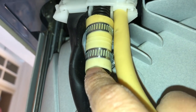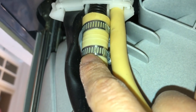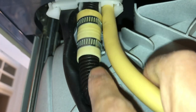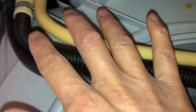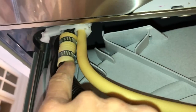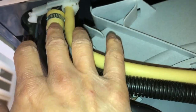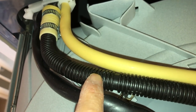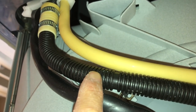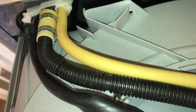It's going to put a lot of strain on this clamp here, so while this will work in the short term, instead what I'm going to do is move this patch into the area where the hose is protected and not moving. I want to pull this hose farther out — I've actually got spare hose to do that. I just got to pull it through. I'll insert the video of how the bending works.